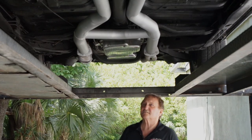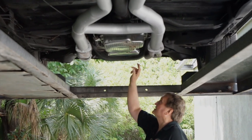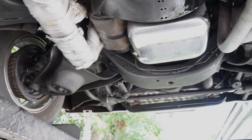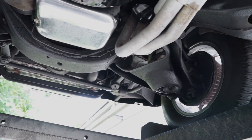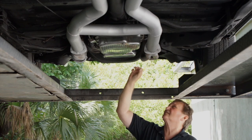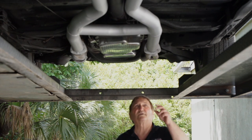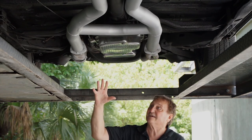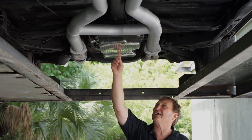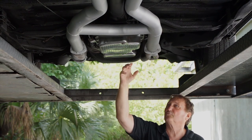This is the underside of our 1967 red Pontiac GTO — really nice and neat under here. New fuel pump visible. Someone has put on a chrome oil pan with no leaks. No leaks at the engine at all. New shocks in the front with what appear to be original springs. Bell housing area has no drippage or seepage. Long tube headers are approximately 1¾" primary tubes going into 3" collectors, feeding into a 3" primary pipe back to the Flowmaster. Deeper Turbo 400 oil pan with a drain provision so you can change oil without dropping the pan.